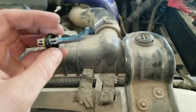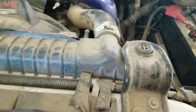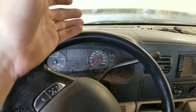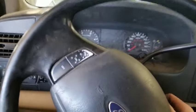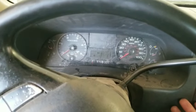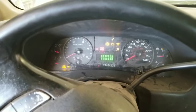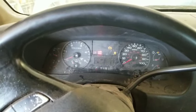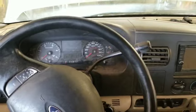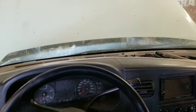So always check the wiring. Here's one more tip for low oil pressure: first thing you obviously got to do is check the oil, because you've got to have oil in it to make it start. One of the things you can do while cranking it is watch the oil pressure gauge — you want to see that thing go up because you want to see it have base oil pressure. When we go ahead and crank it, we'll see it go up. Okay, that'll let you know you've got base oil pressure and oil in it. We don't have high-pressure oil, and that's why this thing isn't starting.